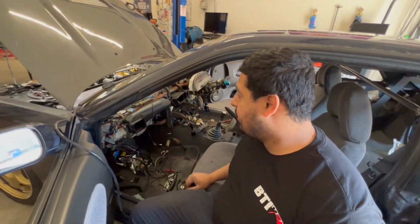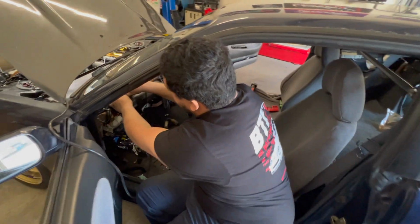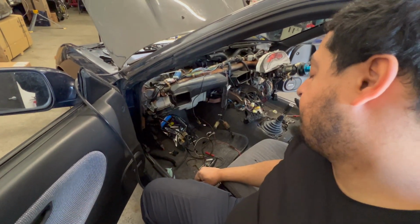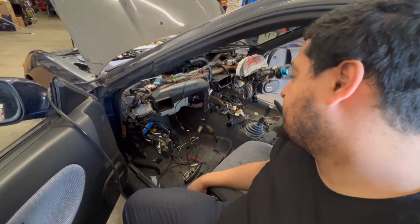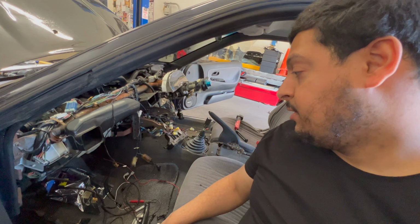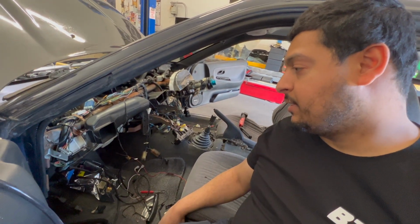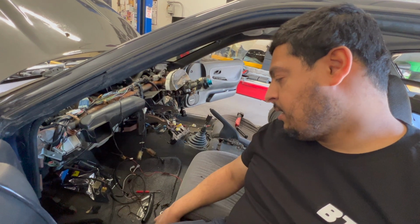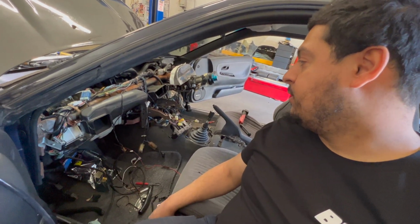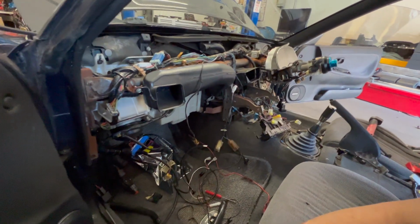The headlights aren't coming on, and even though when I unplug them I can measure power and ground across the terminals, as soon as a load is applied, the power essentially disappears. I can just catch it with a noid light, but it doesn't power it up right, so it's probably either a poor connection or high resistance somewhere that is causing not full power to get over there.